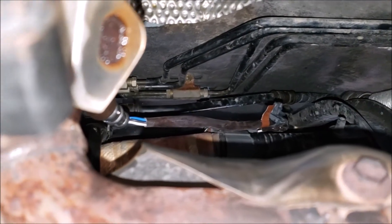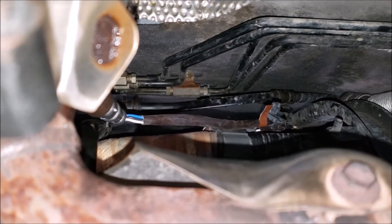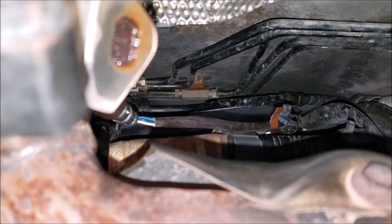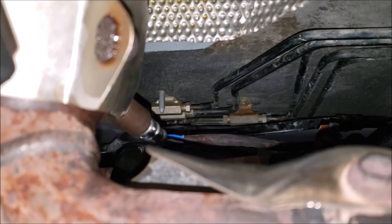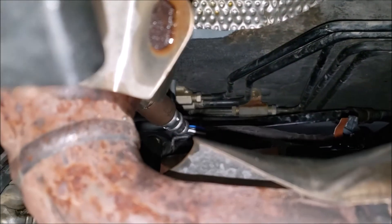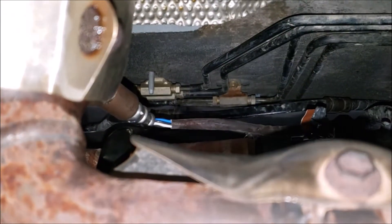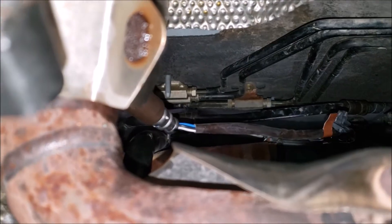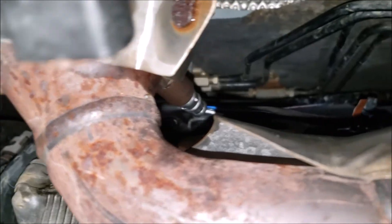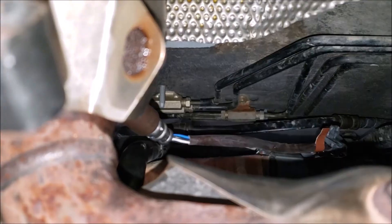Looking back in there you can see the wiring harness — again you have to do a lot of that by feel as well. The release tabs are on top. Just work it off. Going back in is not too bad, but tightening and loosening with the limited amount of space is not the most fun. I did use my open-face O2 sensor wrench, then I dropped it somewhere on top of this plate — I'll have to find that thing. But that's that one done — by far the worst just because of the clearance issues.